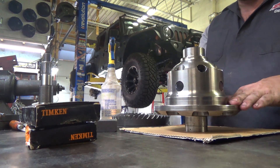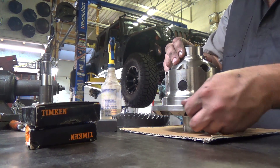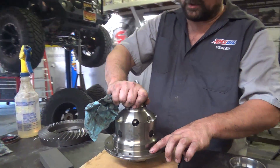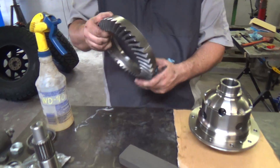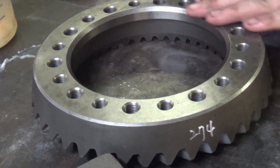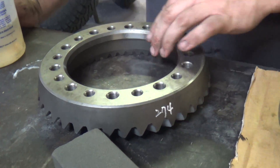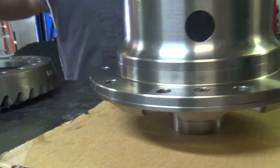You can tell this wouldn't pack the best — see all these bang marks which just came out of the crate like this. If you run your finger across that you can feel this high ridge all the way around here, and there are nicks where the bolt holes are. We look at the bottom of the brand new gears and from the heat treating process there's all kinds of things that can happen — lazy machining, lack of deburring. We can see a nick right there.